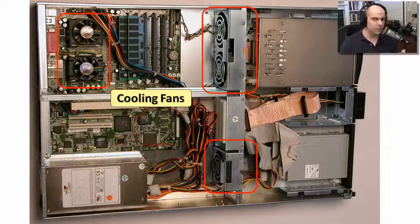We've talked about cooling our CPUs and cooling our memory and cooling our system — and this is where you would have the cooling fans in your system. Somewhere on your computer are the fans themselves. Very often, the cooling fans are the loudest thing about your system because they are blowing air right through your computer. People will often do upgrades to the cooling fans so that they pull air through the system but make it quieter — very important if you're doing things like making videos or podcasts so that your system is a little quieter.